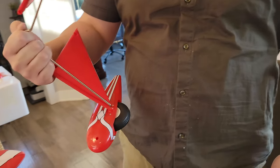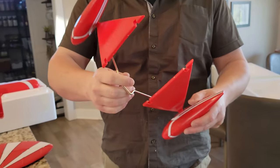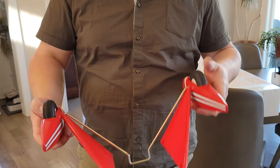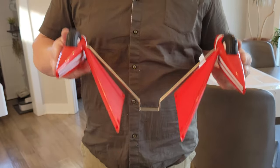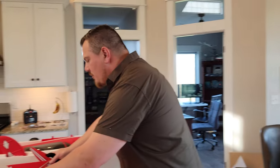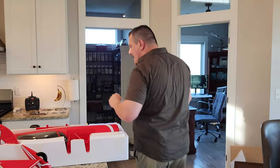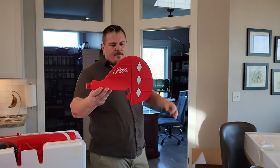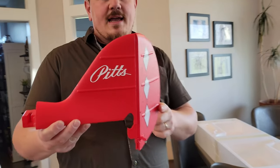The tires are rock hard — literal carbon fiber hard — that's not good. They need to start using softer tires. But these wheel pants do come apart and they are accessible, and they do look really nice with good clearance. If you go to a pneumatic tire, I'm warning you about the pants — you may need to open these up a little bit so the wheel pants don't rub. If you have vibrating wheel pants it is annoying.